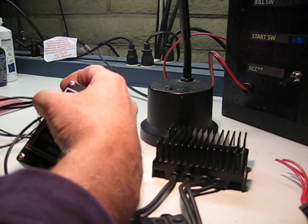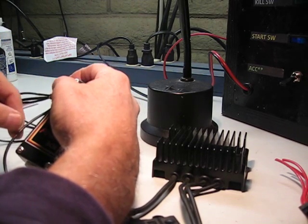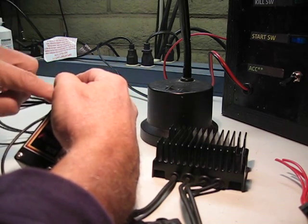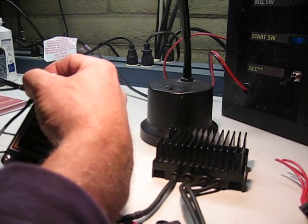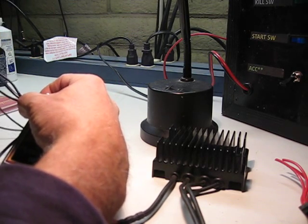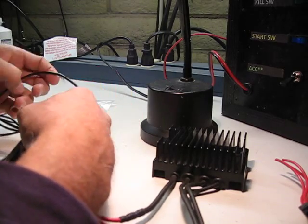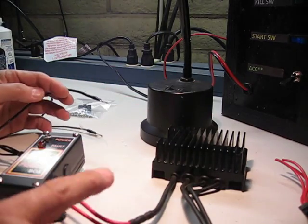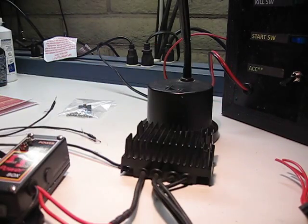That's also the ground that's trying to get back. Remember, all your current that's coming to this point is going to get run over to the RR. And that's what this thick 14 gauge wire is. All three of these other wires are all 16 gauge, but are heavier wire to complement the red 14 gauge wire that goes to our RR.